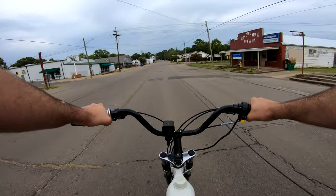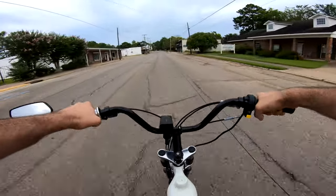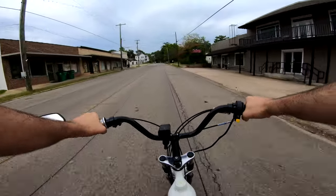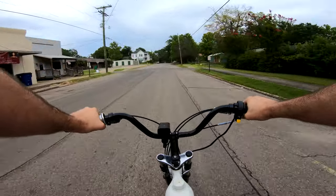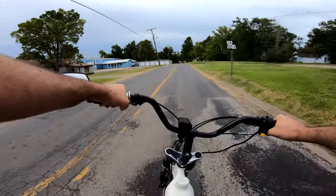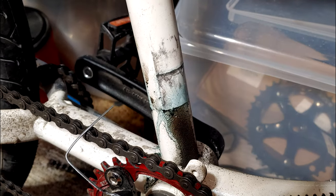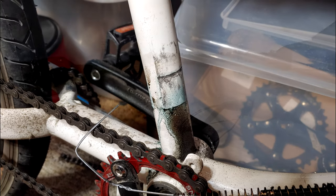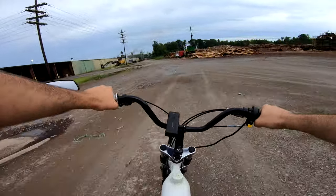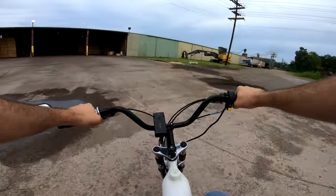But before we start thinking everything's perfect and why didn't they just do this from the start, I should point out, a reminder, the inconsistencies in these intake ports might mean that yours is different than mine. And, well, the intake port duration, I feel, is excessive for a piston port. In other words, I have quite a bit of fuel blowback through the carburetor, so it's not very efficient. You may still want to stick with the reed valve. I don't see any reason why it wouldn't run, and you can even put a smaller, safer window in the piston itself, which won't have nearly as dramatic an effect as the window on the original piston had.